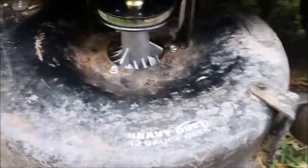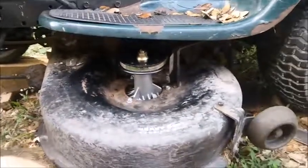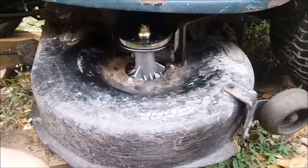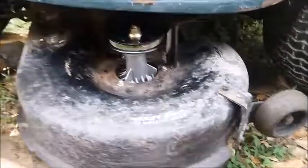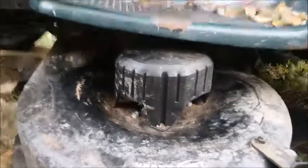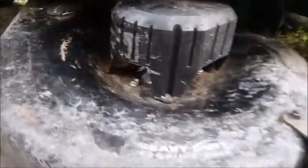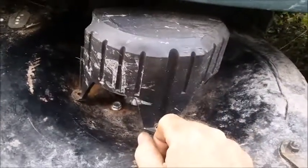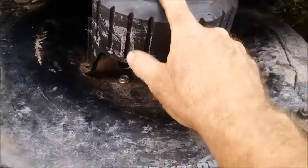On this job we chose not to take the mower deck off, although I'd almost recommend doing that because it did make a lot of extra work. To replace your spindle - particularly if you're not going to drop the mower deck - you've got to get the nuts out of this plastic housing. This plastic housing that covers the pulley has to be removed to get access to the top of the pulley on the spindle.